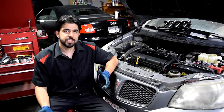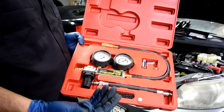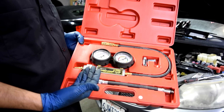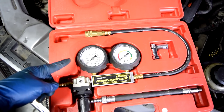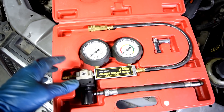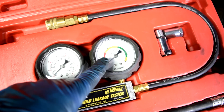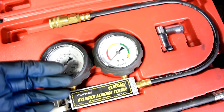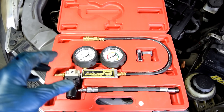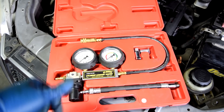If on a car you're doing a compression test and the result wasn't this obvious — that air was escaping into the cooling system — you need to pinpoint the reason behind the loss of compression. What you'll need to do is a cylinder leak down test. You use this kit to introduce pressurized air into a cylinder when it's at top dead center and both the intake and exhaust valves are closed. Then with a second gauge you measure the amount of leak down in that cylinder. Some leak down is acceptable based on your car's make and model because you'll always have some air escaping past the piston rings. But past a certain limit, you'll want to look into why you have excessive leak down. For those interested in buying one of these, I'll put a link in the description box.